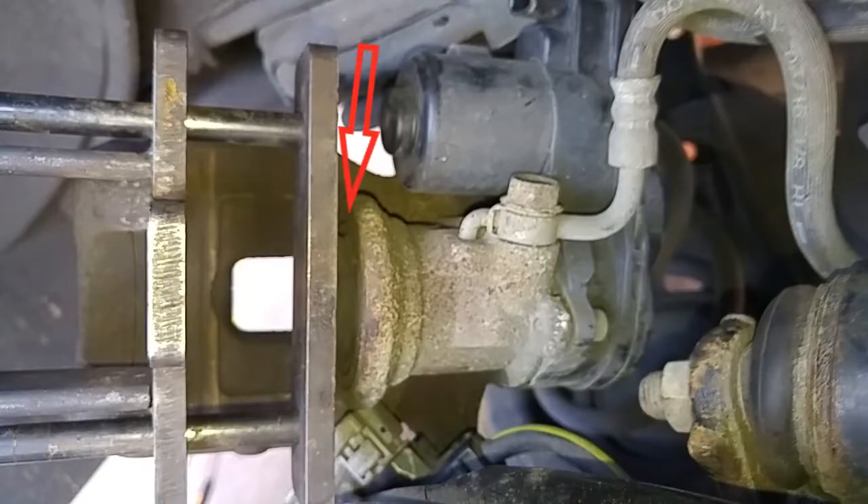So if it doesn't apply any pressure here, then we know that the motor's piston is retracting and then we can start pushing the caliper piston back in.